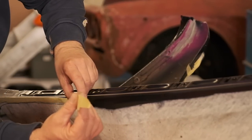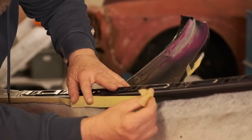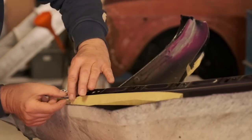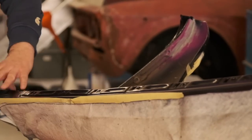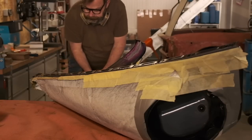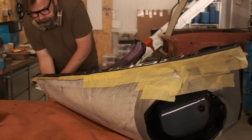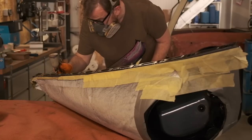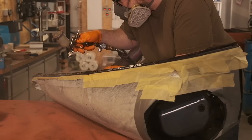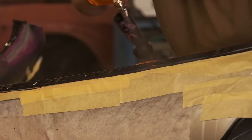I turned to the right side again to apply the final coat of clear. Precautions to avoid overspray need to be much more thoughtful when using two-component clear. It connects to the underground very firmly and can't just be scratched off with the fingernail. In this case, clear was applied to hidden places only, with the will to preserve the, not original, but at least well-matching, external paint.